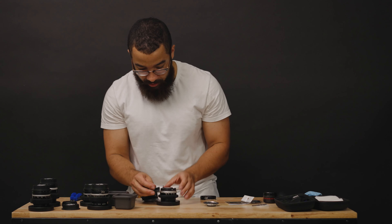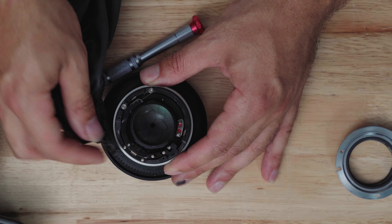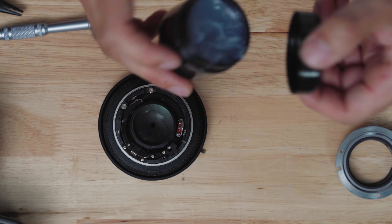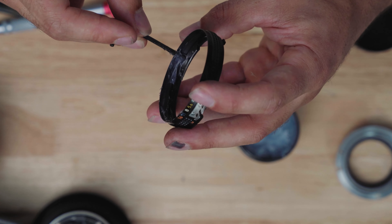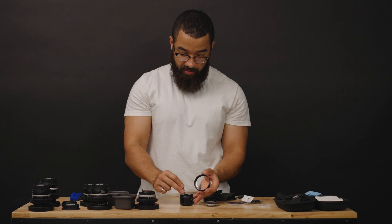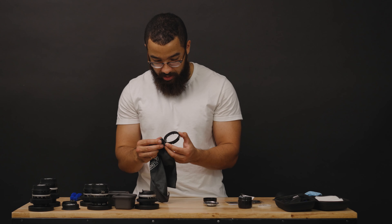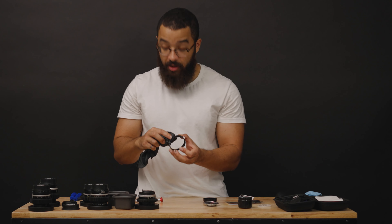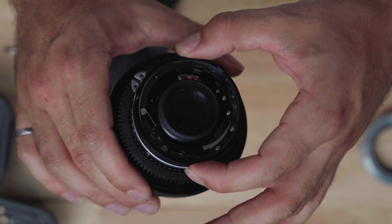Now that I have the clicking mechanism off, I'll put the aperture ring back on — you can see it's very free-flowing, but that's not exactly what we want. We want a very smooth action, and to achieve that we use grease. Taking this whole assembly apart and moving things around, you can hear some scratching — that's dirt and debris knocked loose when taking apart the lens. So I'm going to make sure we have a clean surface: first blow it out, then wipe around where the aperture ring contacts the lens with a microfiber cloth.